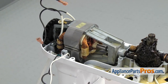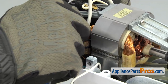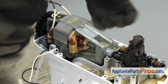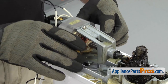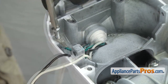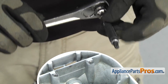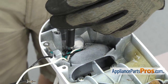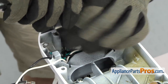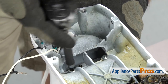Next, we have to take off the motor. We're going to use a Phillips screwdriver to take out the screws that hold it to the lower housing. Now that we have the screws out, you can just lift the motor out carefully and set it aside. With the motor out of the way, we're going to use a Phillips screwdriver to take out the grounding screw. Next, we're going to use a ratchet with a number 3 Phillips bit to take out the big screws — these are in there pretty tight, so make sure you use the right size so you don't strip them out. We'll break all three free and then use a regular screwdriver to take them out the rest of the way.